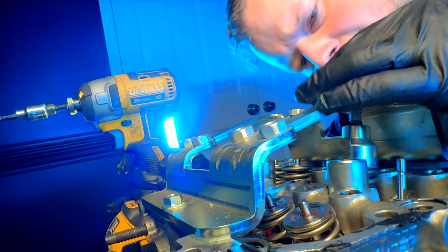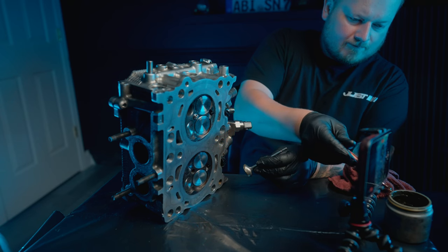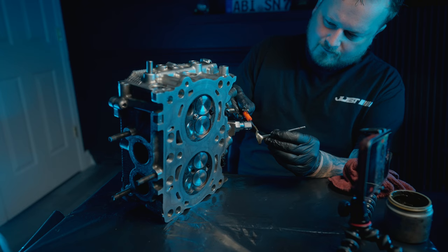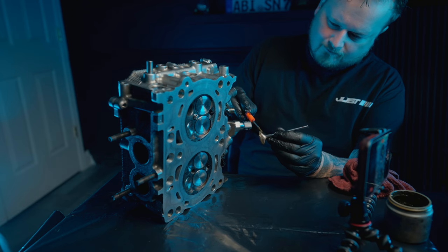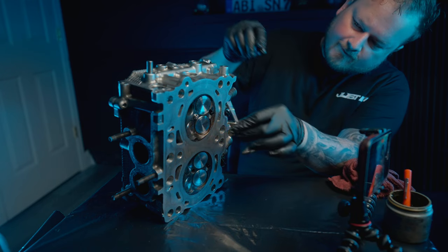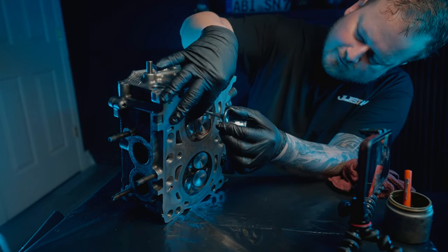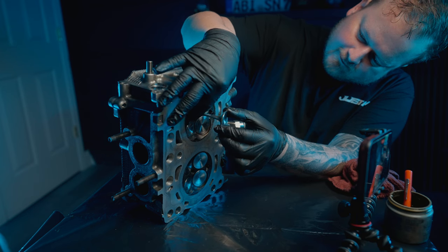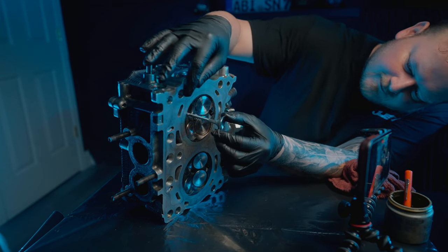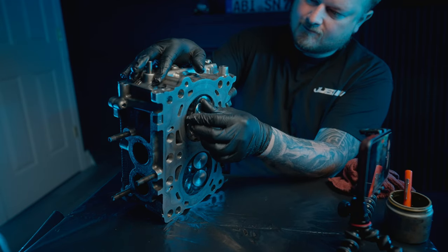I was happy with what we had, so I'm going to reinstall the valve spring — working on the keepers here right now. To recap: you're going to apply a little bit of valve grinding compound. I've found a little pocket screwdriver works best. Keep the compound off of the valve stem itself — keep it on the face, the seat of the valve.